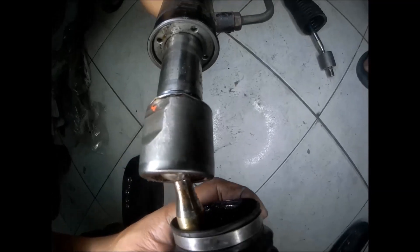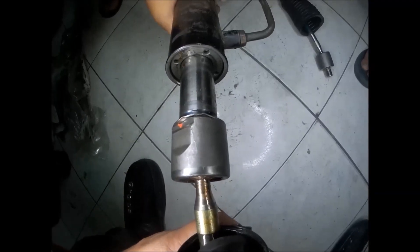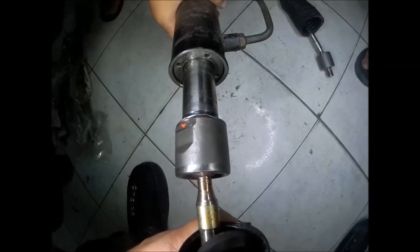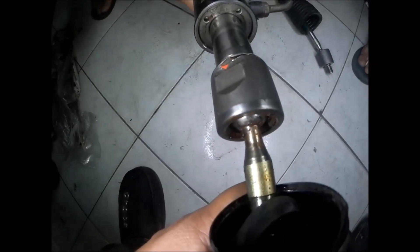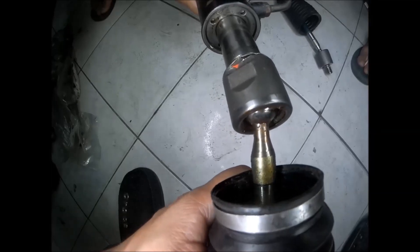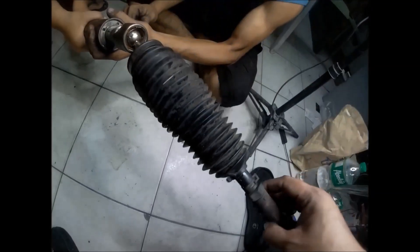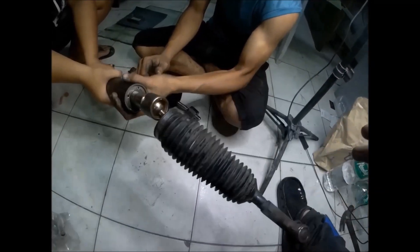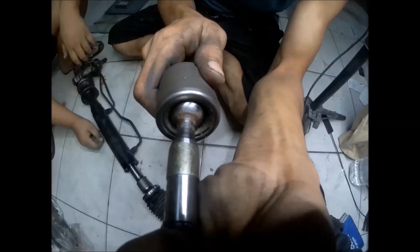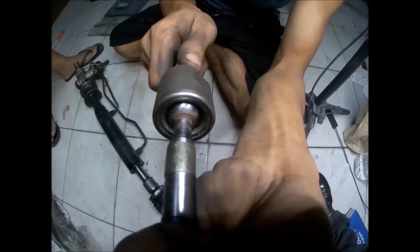You can see the ball is moving inwards and outwards — that's an indication that the rack end is worn. And whenever you lift the rack end, it easily goes down; it's not holding itself in position anymore.